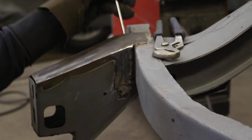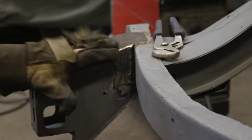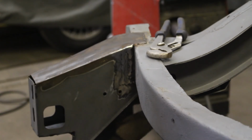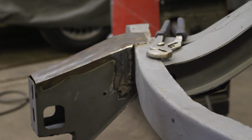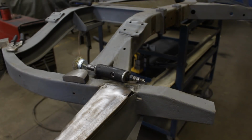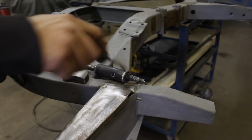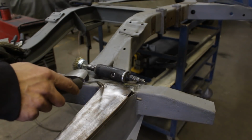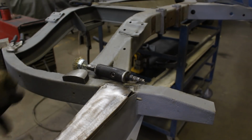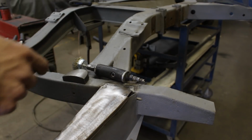Now, there's the hole here, which is for the water to go out, because you know this is going to be the other way around, and this is going to be the low part here, and this is like a little bucket here, perfect to hold water there. Okay, this is the other one, but you're closer here anyway, so you see this opening here. I'm sure there must be another one here, so I'm gonna drill holes here and on the other side as well, so if there's any water gathering on this side, it can also drain out.